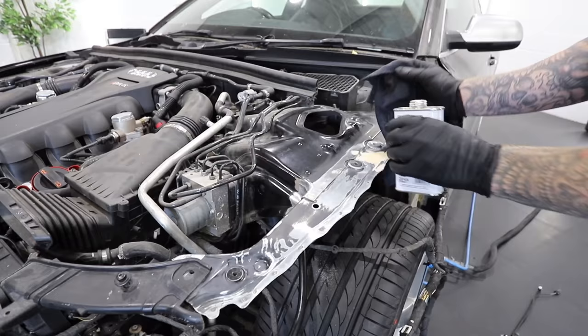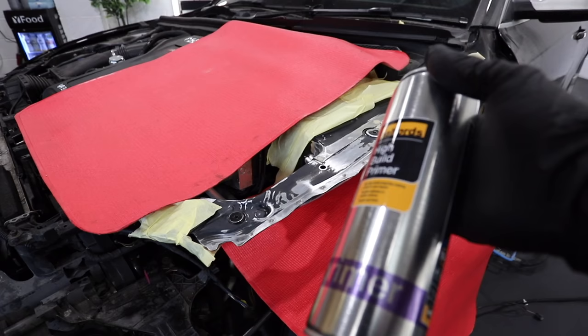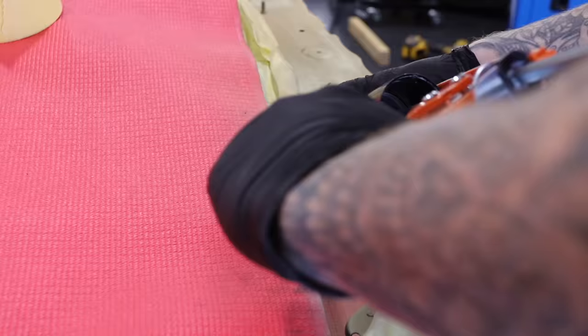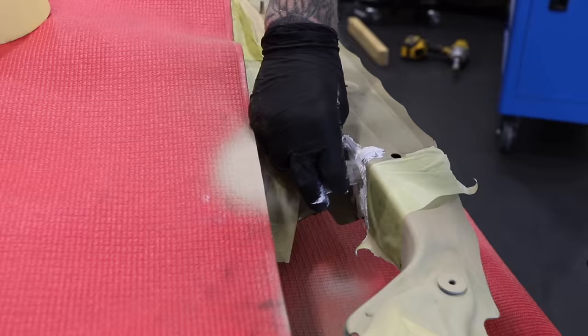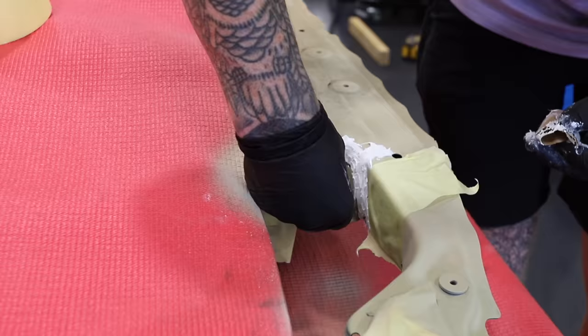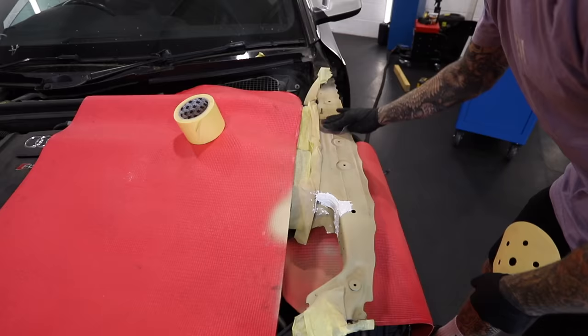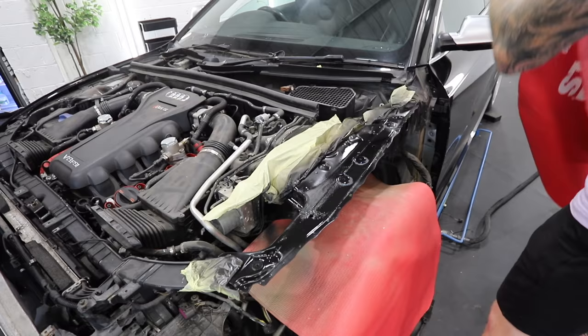First up is the thinners. We've got to make sure that this surface is nice and clean and ready for paint. Time to mask the area and then the high build primer is up - I'm going to spray this all around the area. It's really thick paint and it should cover up a load of the scratches. Then I've jumped ahead with this sealer - this is just to seal any gaps in the panels and to stop rust. As you can see this is the OEM side which mine probably won't look like. Then once the primer has dried I begin to rub that down with a bit of sandpaper. Then I can give it a nice base coat of Panther Black which is actually the colour of the RS5.